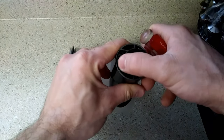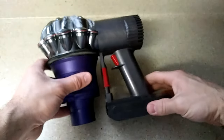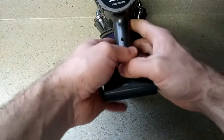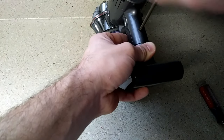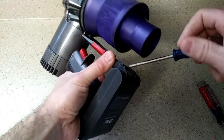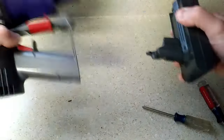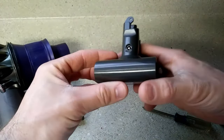Again, there are your electrical connections here — try not to get that wet. If you do get it wet, make sure it's 100% completely dry. Set that aside. On the Dyson unit itself we're going to go a little more detailed than most people. You have two screws to remove the battery — one in the front and one in the back, both Phillips head screws. Make sure you place these screws on a paper towel — you don't want to lose them. You can actually get non-OEM batteries for these on Amazon reasonably cheap if your battery goes bad. Dyson wants $75 for the batteries, which is a little high. Then the battery will just be removed. As you pull the trigger there's a little button here that engages the engine, the suction device on your Dyson.